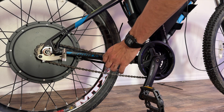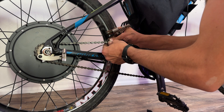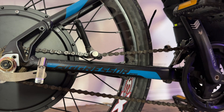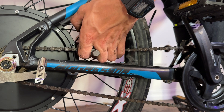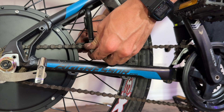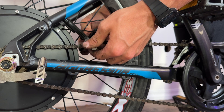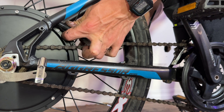After that, the last thing we needed to add to our bike was our chain. I did this by using a chain linking tool. You might notice that I removed the gear shifter on this bike and just put the chain on the highest gear possible — that's because on a bike like this, there's really no need to have low gears since you're going to be using the throttle 99.9% of the time, and the chain's really only there to keep your crank stiff when you're going at lower speeds.